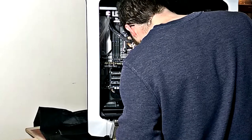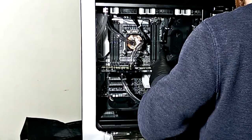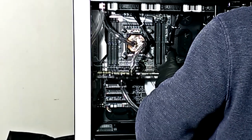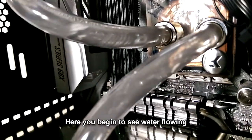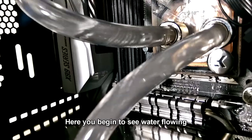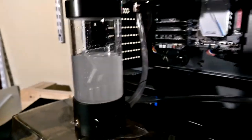Here as we zoom in, you can see the water flow beginning to happen in the tubes — applying pressure, getting flow, applying more pressure, getting more flow. There's a lot of air to be worked out of the system because initially the only thing in the tubes, reservoir, and radiator is air. Now we have water flowing through the system. As you can see, there's still a lot of air bubbles, but that's to be expected — those will work themselves out as the water hits the reservoir. There are also bubbles in the heat sinks but those will eventually work out.